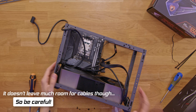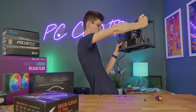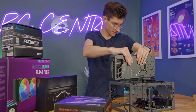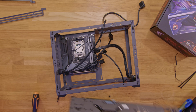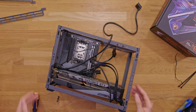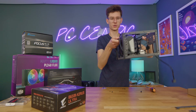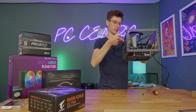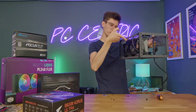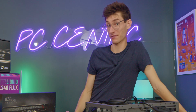That looks good. I mean, you're not going to have a ridiculous amount of room underneath it, obviously, because it's such a wide GPU. What about something even bigger, a 7900 XTX from TUF? No, that's not going to work. What about a 3080 Ti from Gigabyte? That fits in without problem. And you do have a little bit more room down the bottom now for the GPUs to breathe. So I'd say 2.5 slot is probably optimal. 3 will work. 3.5, it might physically fit, but that is definitely not going to be ideal.